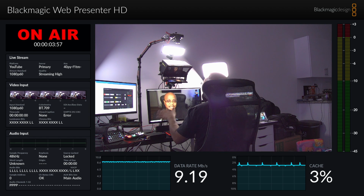The reason I didn't like them is early on, there used to not be a secure protocol to live stream. That was RTMPS. That was an option. But when Facebook made that change, a lot of these hardware encoders were hard coded to the unsecure setting. So you had to wait for the vendors to update it before you could use it again. So it knocked a lot of people out. That was including Boxcast, a bunch of other products like that. That's the reason why I didn't like it.